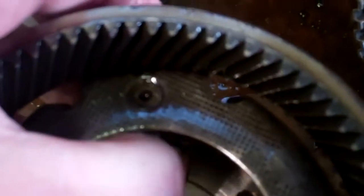When it's starved for fluid, the planetaries here spin on needle bearings, and because they didn't get lubricated — there you can see it — see that, how that pin, this gear is just wallowing around. And this is where all that metal was coming from.